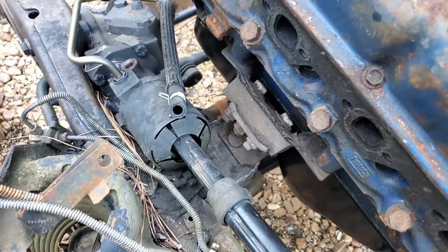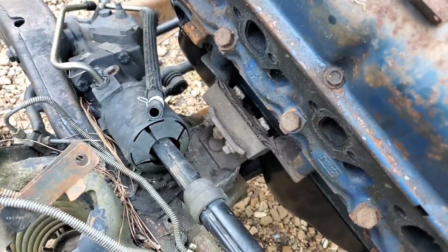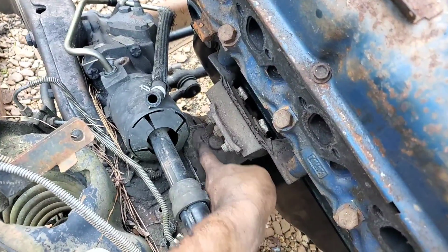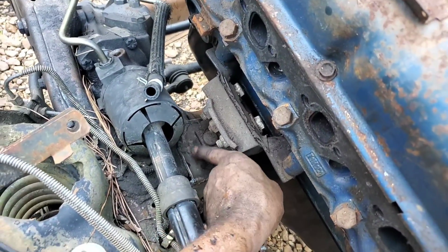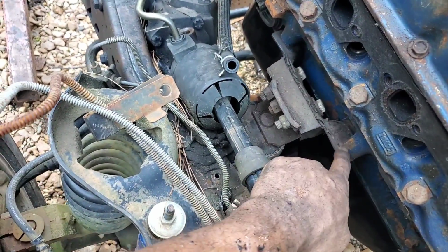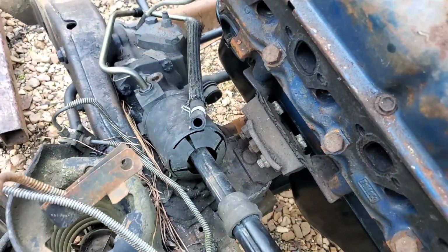But yeah, what will end up happening is both of these motor mounts are going to be permanent mounts, first of all. Secondly, I will probably find myself welding all of this from this plate right here, welding this whole thing to this Ranger bracket right here. And whenever I have to take the engine out, I would separate these motor mounts from the two bolts on the block itself to get the thing out.